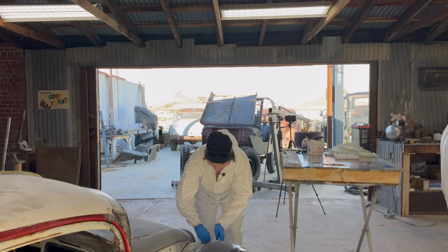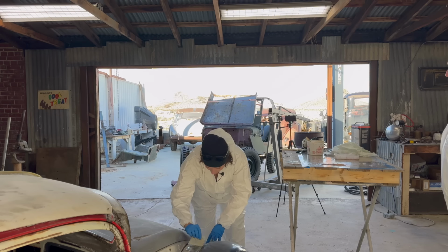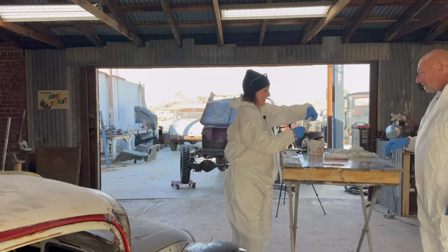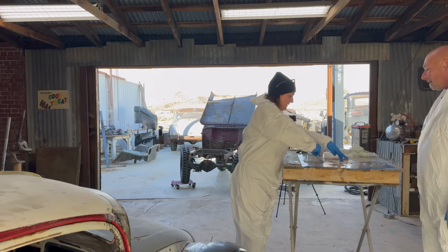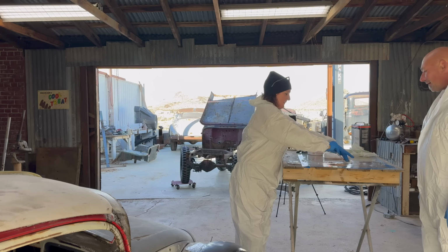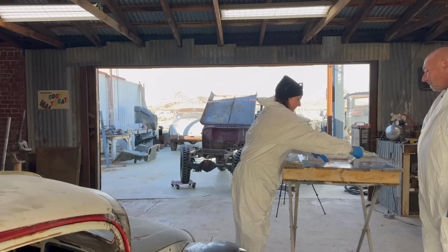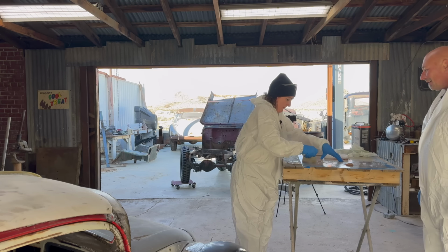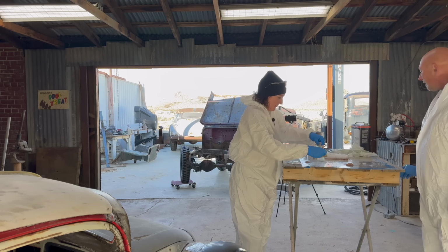You could tamp it down with the spreader if you were trying to keep your hands a little bit cleaner. That's so satisfying. Right? Yeah, set up your next one. Exactly. And you'll come to a flow where you'll start to learn how fast this sets up, how much prep you need to do in advance, and see how it absorbs it. Since it's all full, screed it off. Set it down. Screed, screed. Exactly. Sweet. Is that okay? Yeah.